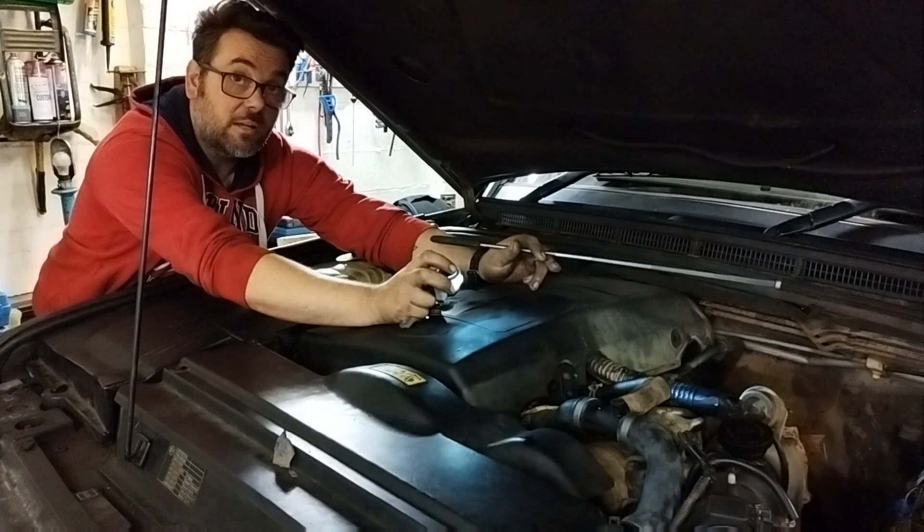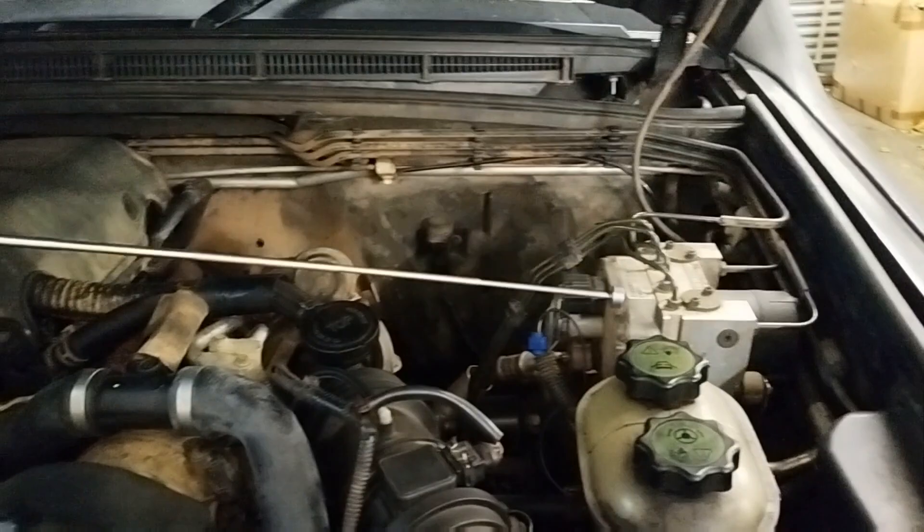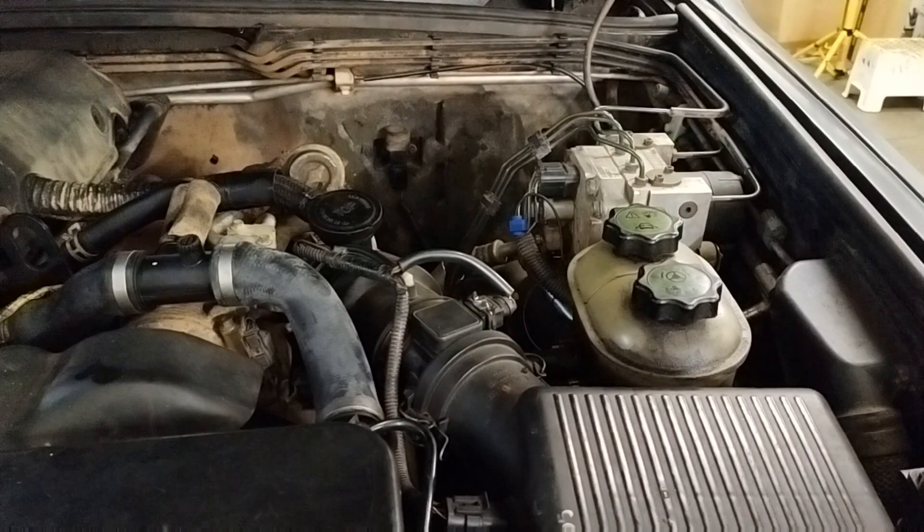If it's still on air suspension, make sure it stays up, makes sure it pumps up, and make sure the pump's not too noisy. Your ACE — Active Cornering Enhancement — check the fluid level. This one's on minimum, which if it's quite low probably means it's been leaking. Check under the car to make sure you've got no leaks from the ACE suspension, because that can be pretty expensive. We'll show you those points to check when we're underneath the car.